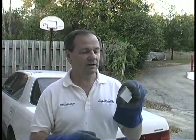On my car, I'm going to be using one that's about 2 inches, maybe about 2 by 2.5, and a little about a half inch thick. This is about the size we need. Now, cars that are too small need a magnet like this. If they're too small for the detectors to pick them up, or pickup trucks, a lot of times the ground clearance on a pickup truck's got all the metal mass too high off the ground, and it doesn't pick up. But this is how you can help that out. Watch as we show you how to install this magnet.